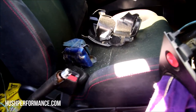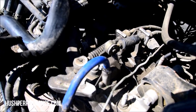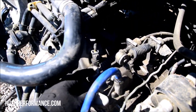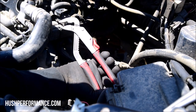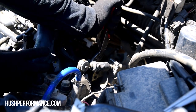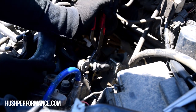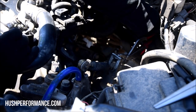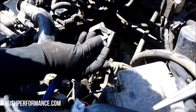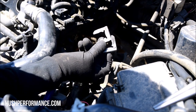I've already looked this car over. The seats are in pretty good shape - I'm going to take these seats because I know one of my buddies will want them. EP3 shift cables aren't very desirable, so we're not going to take them, but we are going to take them off the transmission. There are two cotter pins and these clips. If you take a pair of channel locks - I have this set from Knipex - grab the lip of it, roll the back side of the tool on the cable, and it's going to lift up pretty easily. That was the one we wanted right there.